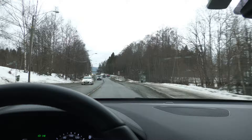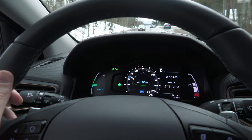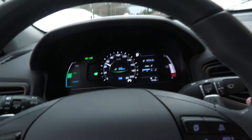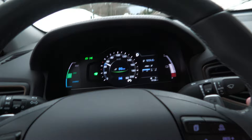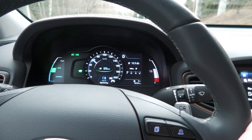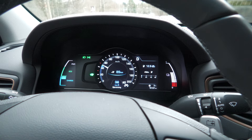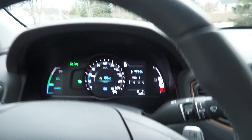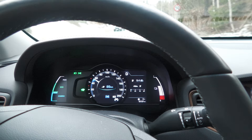So the question is: why do you need to do this? Why do you need to employ this trick? The reason is that EVs regenerate. I can adjust the regen with the paddles on the wheel. But still, if I press the brake now it will regen — at least in this car. For instance, in the Tesla, when you press the brake pedal it applies the friction brakes, so I don't have any issues there. But for this car, the best way to apply friction brakes is to go downhill like this.